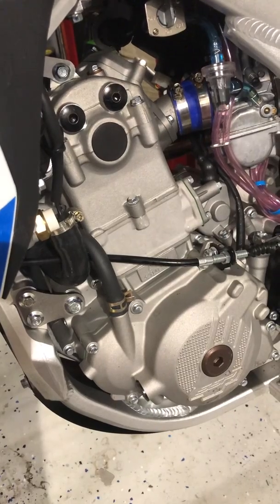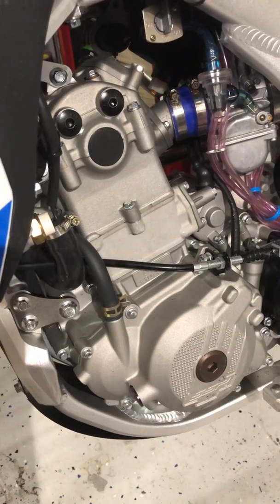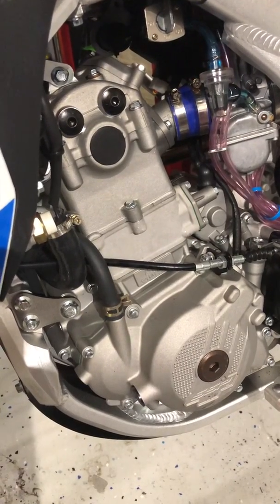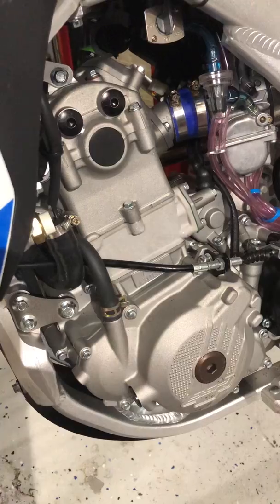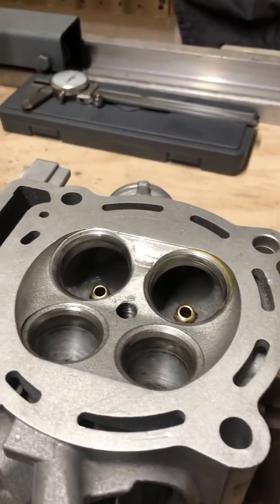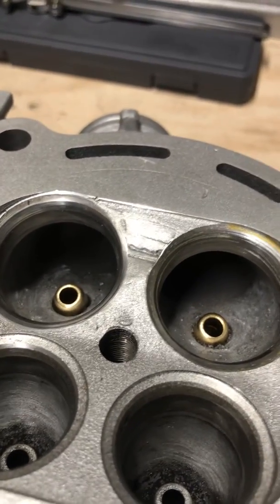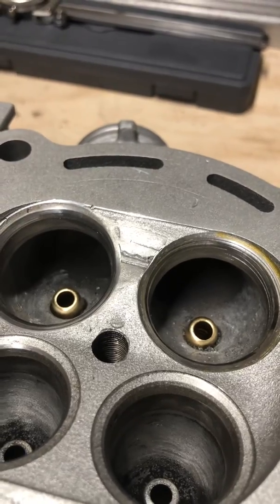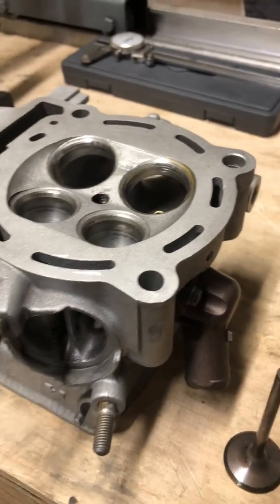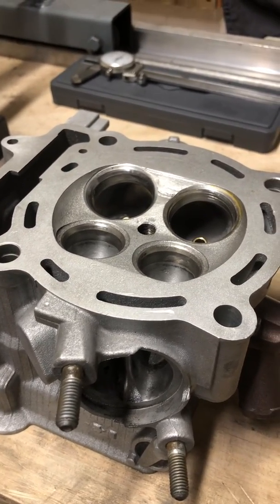I watch what's going on. I did a lot of research before I bought this motorcycle, even down to engine components, and we're going to go into that a little bit today. Here we have a KX450 head that snapped its intake valves and you can see the damage — it's not horrible, but you can see between the valves where the valve actually smacked the head.